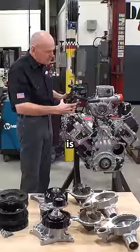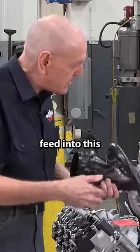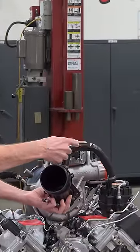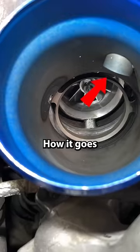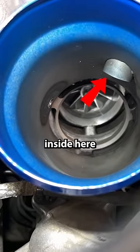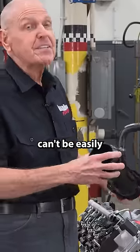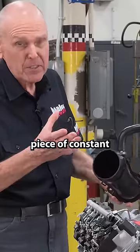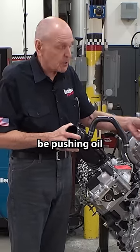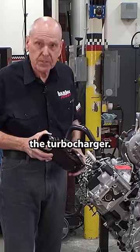The other part of this is that the feed into this intake has to have the correct pressure in this line. How it goes into the airflow, and even the shape inside here, can't be easily duplicated with a piece of constant-diameter tin pipe. You've got to know what you're doing, or you're going to be pushing oil into the intake on the turbocharger.